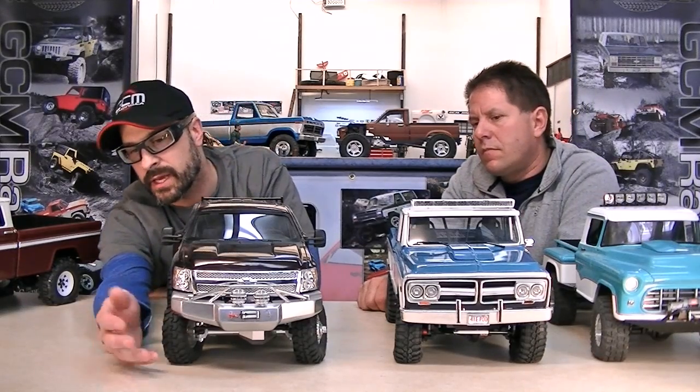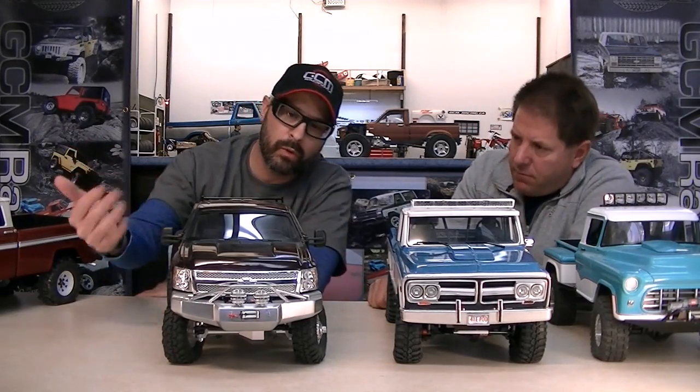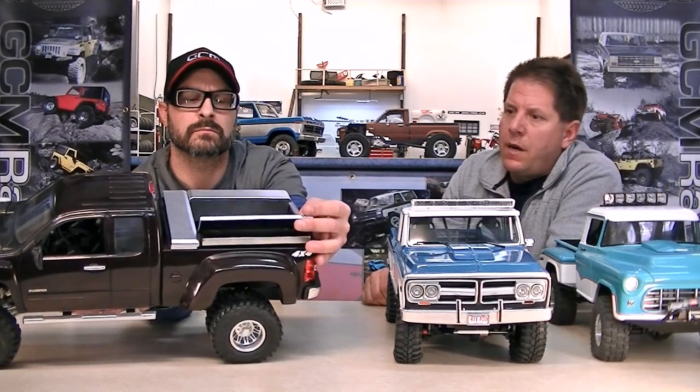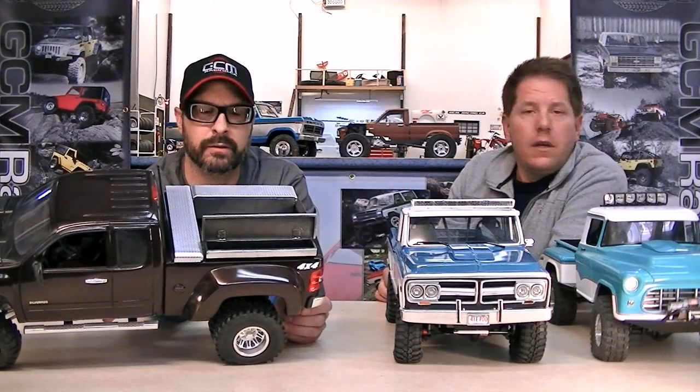So basically this whole front end is a custom build, right out of 16-gauge steel. Really well done — it adds so much to this whole project. Any modifications to the roofline? Not the roofline, but the hood — yes. I put the vents on the top and raised the hood. These aren't stock — I built those out of diamond-plating ABS sheets, made some boxes, wrapped it around, glued it, and painted it up.